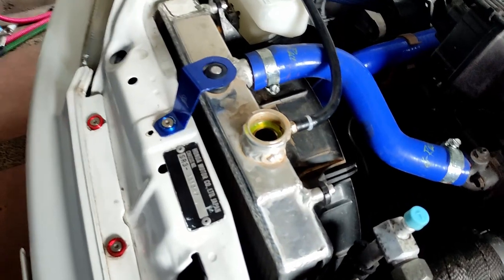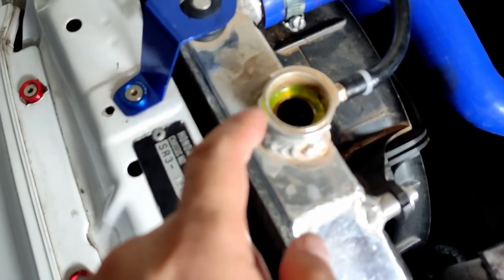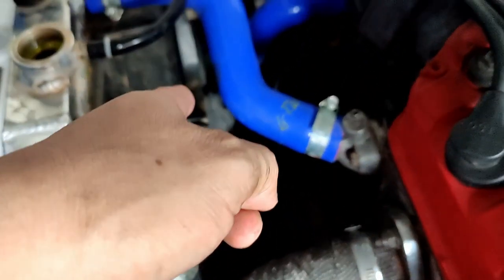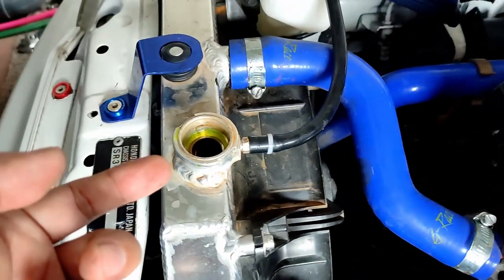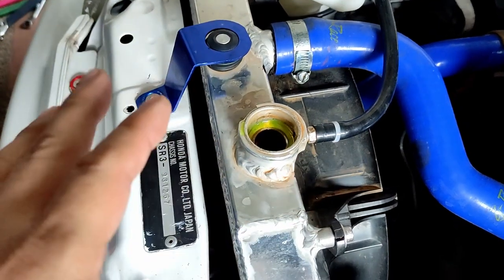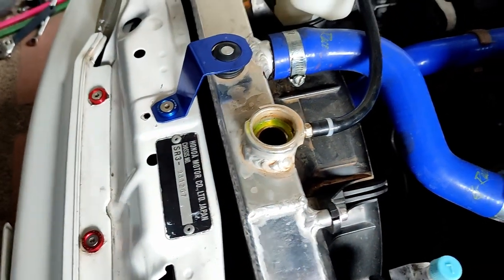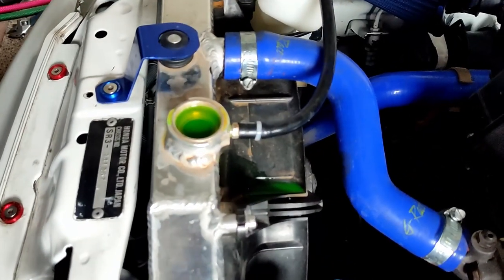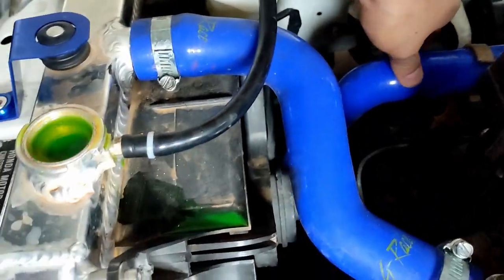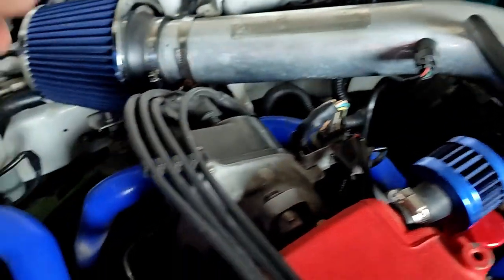Finally, as soon as I started the car engine, it sucked some coolant, and I need to add more and then wait for the rad fan to turn on and off, and then wait for the air to come out, add some more, then turn off the engine when it's all done, then place in the rad cap. I forgot to mention, we need to press the hoses so that the air will come out. I think there are only two or maybe three at the back.